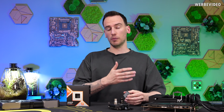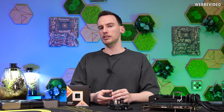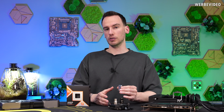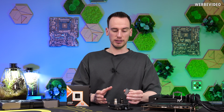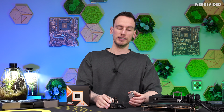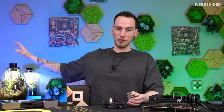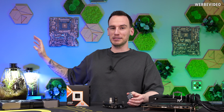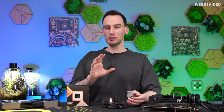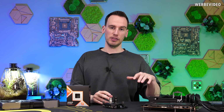In the first video on this topic we used the 280 ASUS AIO. The temperatures were about 80 to 85 degrees Celsius under high multi-threading load, which was okay. But for a better comparison, I today want to just use a normal custom water cooling block with the Mora that is still under my table. I still want to finish this Mora project with the Mora that's already mounted on the wall. It's still not fully functional. I just didn't have the time to do that, but we will soon work on that project. But for now, I'm still going to use the 360 Mora underneath my table.